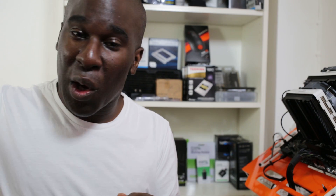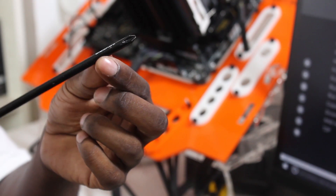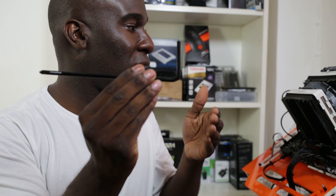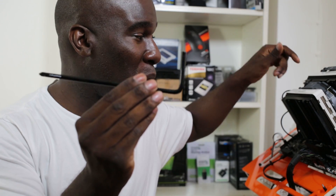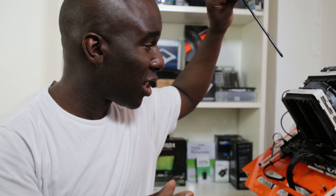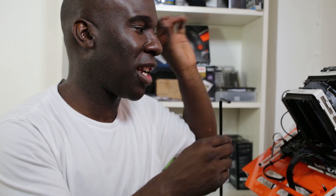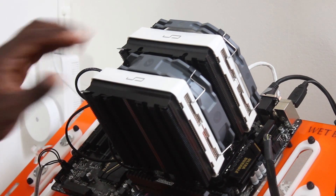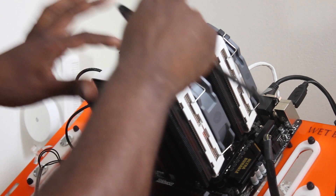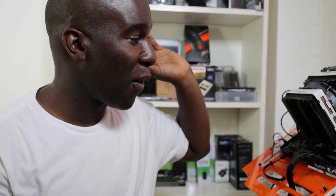I like that they've included an actual screwdriver with the CryoRig branding on it. It makes installation so simple because it's got holes pre-drilled in the CPU air cooler so you can just put the screwdriver straight in and screw it down. None of this taking the fans out and breaking the rubber clips that connect to the fins — this is all already done for you, and you can change the fans if you feel like it.